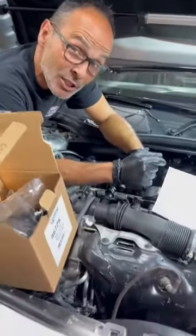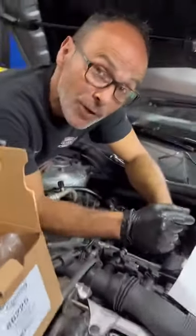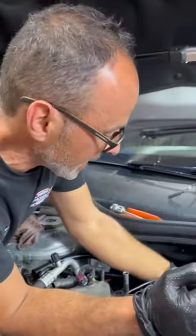Hi, Mark at Urban Automotive, Oakville, Ontario, Canada. Thanks for watching our YouTube channel and subscribing. We have another tech tip here. I have a Mercedes-Benz CLA 250 that seems to be overheating — the temperature gauge is fluctuating, going hot to 120, then down to 80, then back up to 120. That fluctuation is what we need to address, so we have to get the thermostat out.